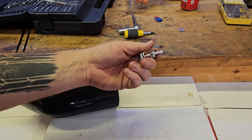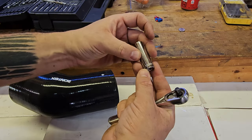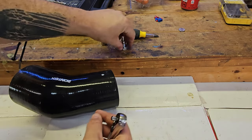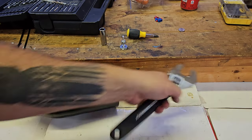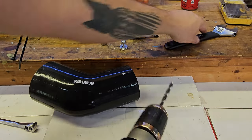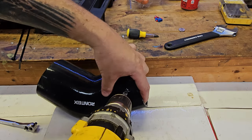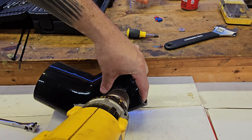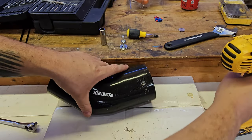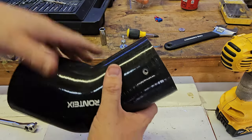If you choose a different barb fitting, you'll need to know exactly what size tools are required. I'm using the Vibrant one — there'll be a link in the description below. What you need is a deep half-inch socket for the lock nut, an adjustable wrench to hold the bottom, and a drill with a 9/32-inch drill bit to drill the hole. Find where you're going to drill, create tension with your fingers spread apart so you don't drill into them, and drill straight through.